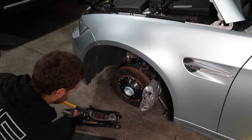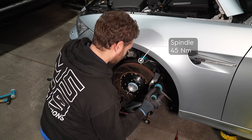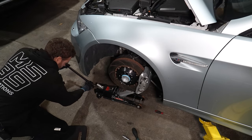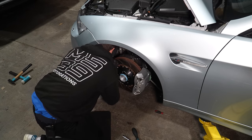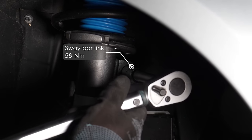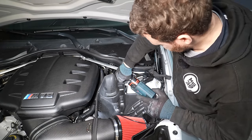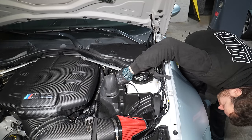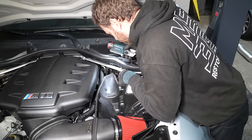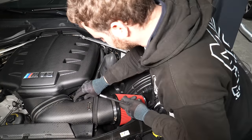Okay, Hugh Jackman is ready to dance. Okay, that'll do. We can relieve Mr. Jackman of his duties. Now we can put back the tie rod. And now the wiring, I'm gonna sneak it past the fender liner and then through the box for the wheel speed sensor and the brake pad wear sensor, and then zip tie it along the wheel speed sensor wire, and it's gonna look nice and clean and be safely out of the way. Okay, I zip tied everything underneath. Now we just gotta do it here. I'm gonna remove the air filter box for better access.